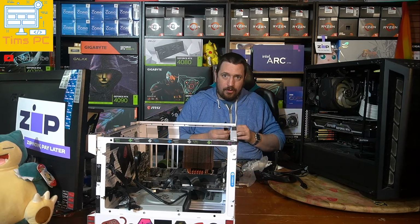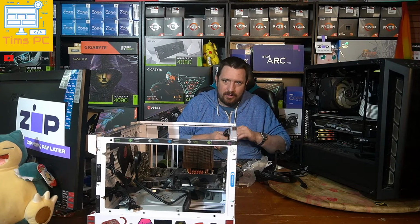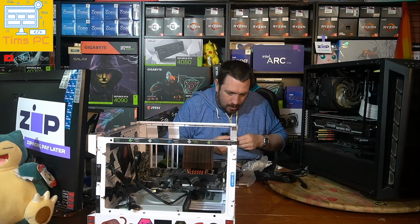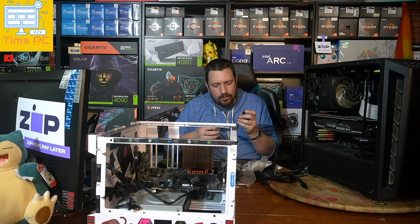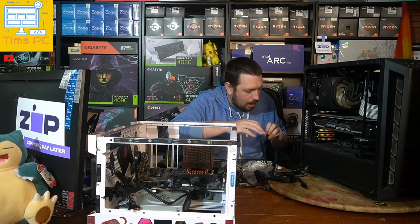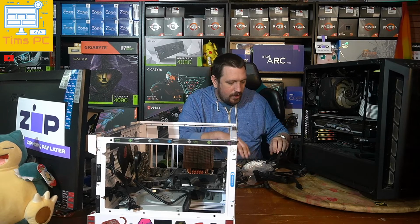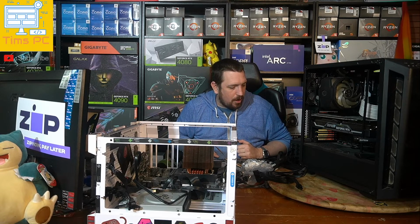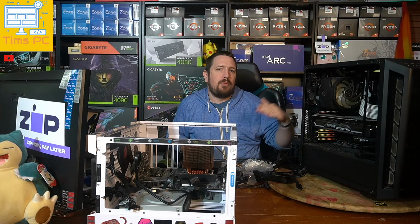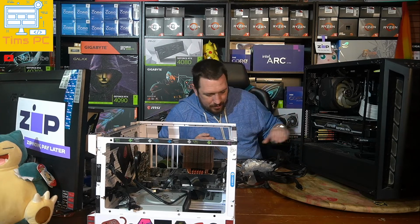If one of the things that really concerns you about owning a PC is how much power it uses, then maybe the efficiency of the power supply is something you might want to look into. But generally, it scales when you're running a lot of computers. If you've got a big office with hundreds of computers running all day, you can make a good case that over a couple of years, the money you'd save from investing in slightly better power supplies for everyone's computer saves you enough energy to be economically justifiable for the extra expense. But it really only happens at scale. For ordinary people, it's not as big a deal.